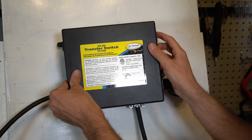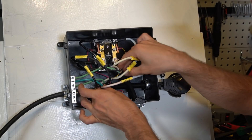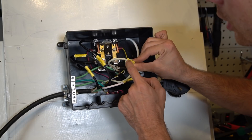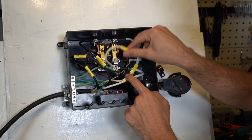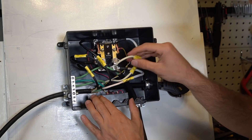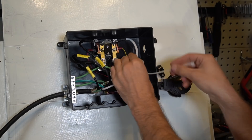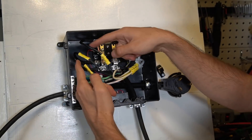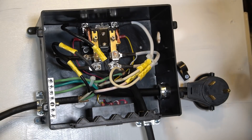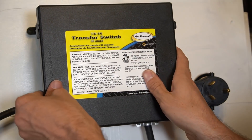The wires may be a little messy, but if they're not touching the switch and the cables are secured properly, you are good to go. You can put the cover on and be totally fine. Always think about improving organization — zip tie power cables together if possible. Take note of your crimp connections: if there is any conductor showing and there's vibration on the road, it could short out. Make sure you did a really good job. You could zip tie the neutral wires and the ground wires together.